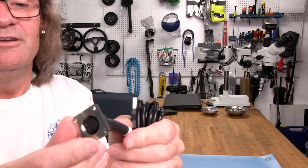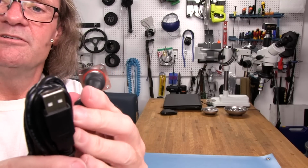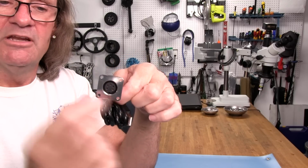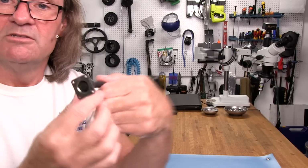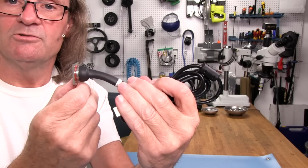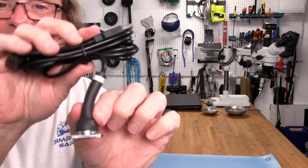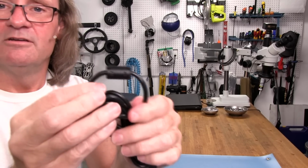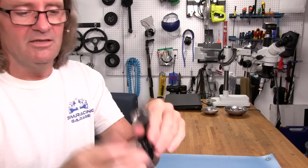And it's really a little bit of details. It's very cool here. On the back, you can see there's actually a rubber O-ring system there. So when we put this in the panel and tighten down with the 4 screws, it seals a watertight connection, or at least a water resistant connection on that panel. So if you're throwing your beer around while you're racing, you won't have to worry about getting it in the electricals. Again, little details like this. And this one again has a little decal on it that says pass, right? And we have a little ferrite core here to help reduce any effects that EMI might be causing or not. And it's just all heavy duty.